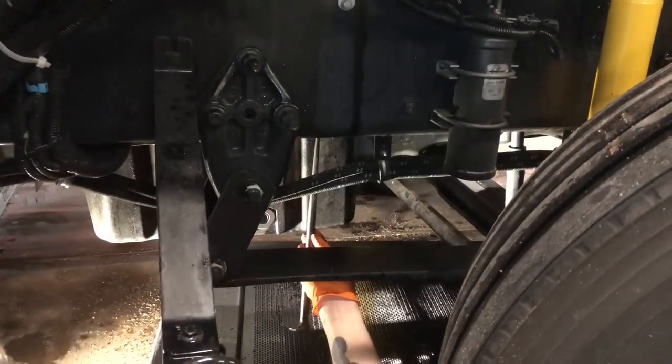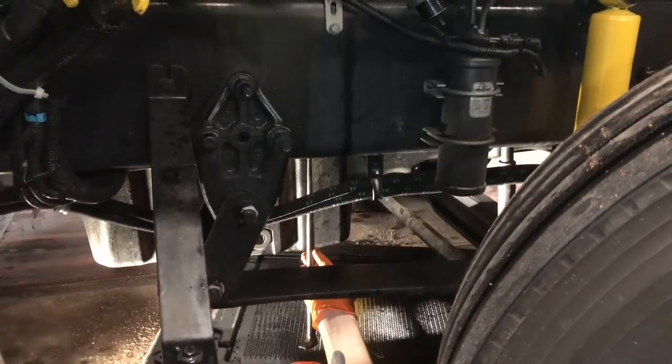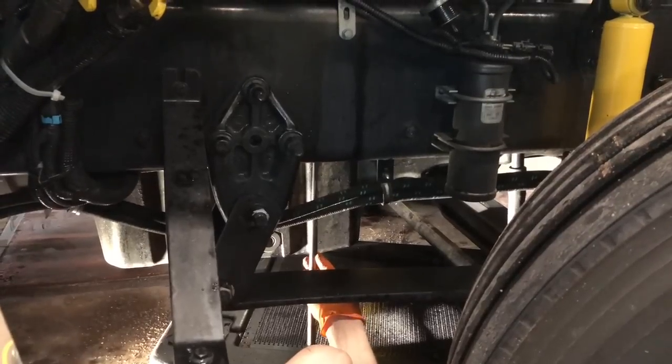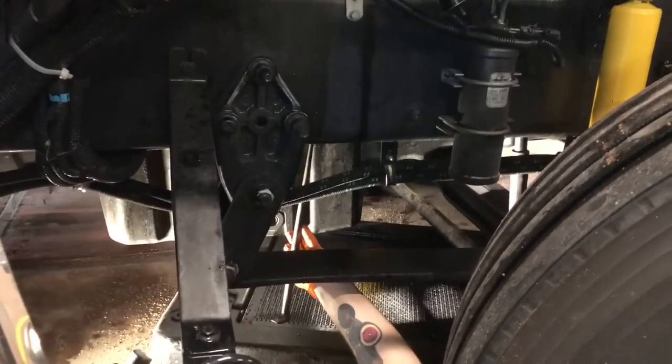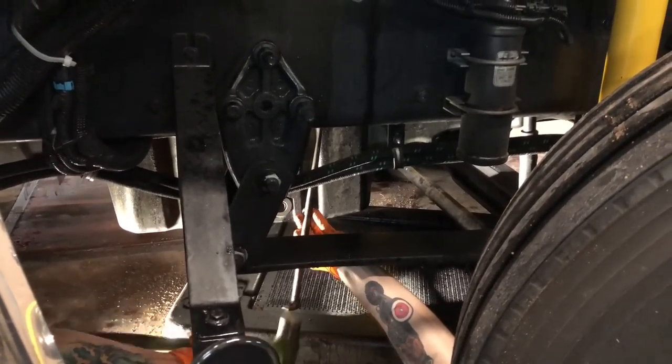All right, what Bill's done, he has loosened the filters with a filter wrench to make sure they come loose, and then twisted them back up hand tight. And you'll start with the filter that's the furthest away from you, and that way you're not working in your own oil. Punch a hole in the bottom and just let it drain in your oil pan.